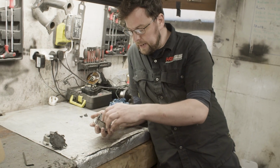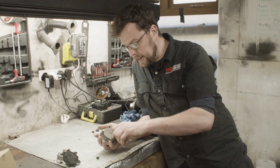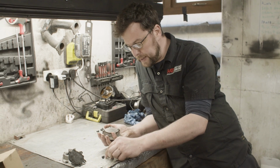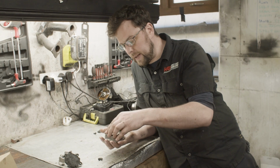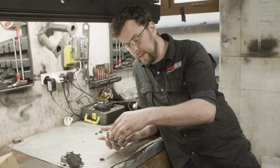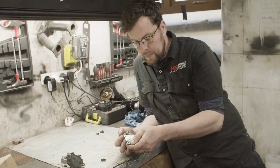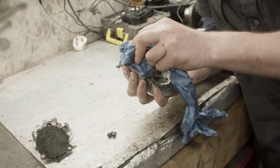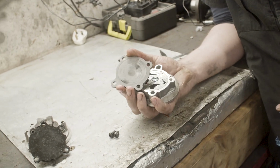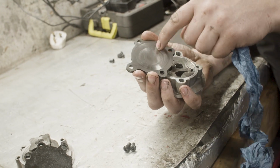I just took apart one of these AP UK pumps. This is one I just have in stock here, and that, by the way, was supposed to be the turbo oil pump option. Straight away, the difference here, I can nearly pick that pump up by the back plate. I can actually feel a vacuum happening there, and the reason for that is because you can see the back of this back plate is actually properly ground, precision ground, and has that smooth surface.